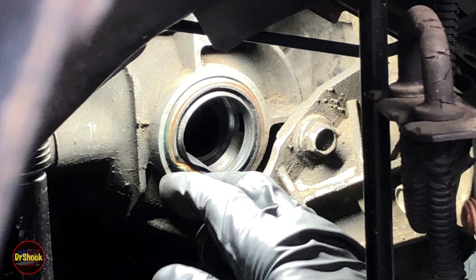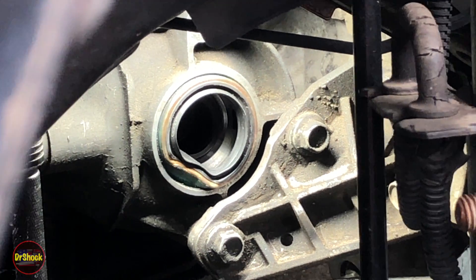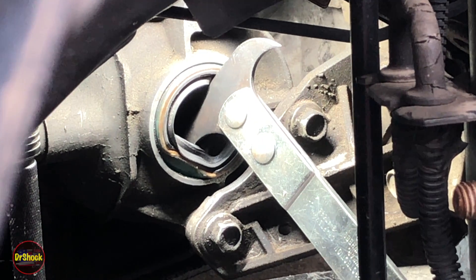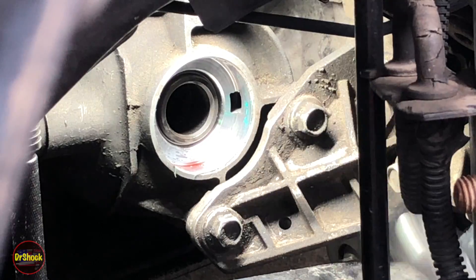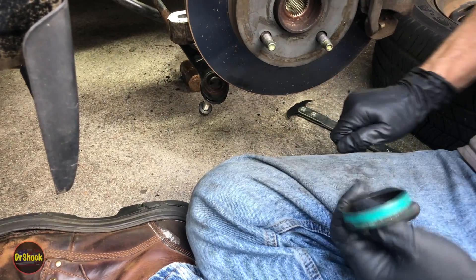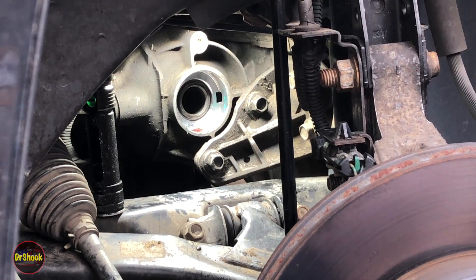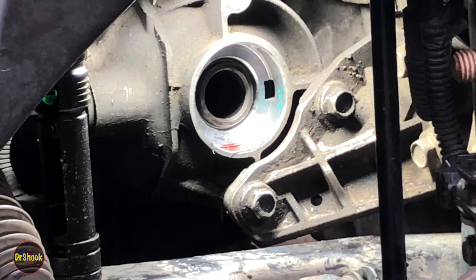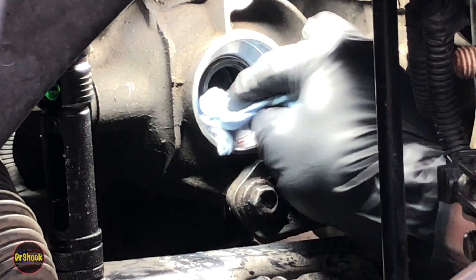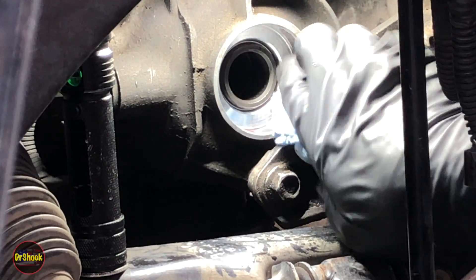What we're trying to do is just collapse the circular state of the seal so that it'll be more vulnerable to coming out, and then at some point we'll be able to come in with another tool and get this extracted. And there it is — the old seal is out. I just prefer that method; I find it's better for the close quarters we're dealing with here.